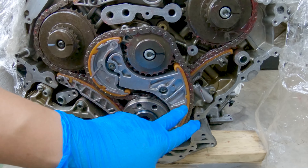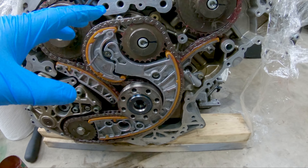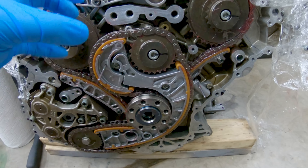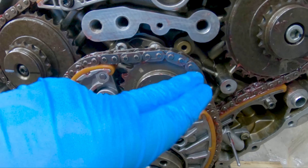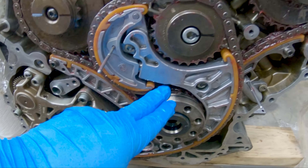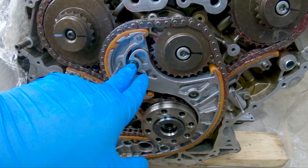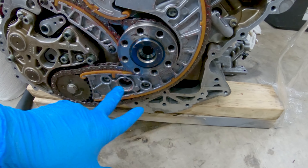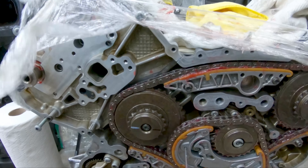The center guide is on — it actually took me a little while to finagle. You've got to find a way to maneuver and put the chain and the guide on at the same time, getting it around this sprocket and the lower one and the middle one too. Finally got it. I torqued these four bolts to 10 Newton meters — one, two, three, and four.